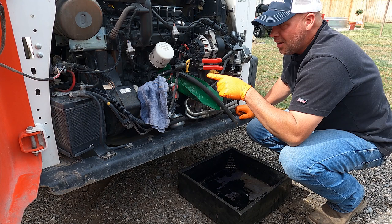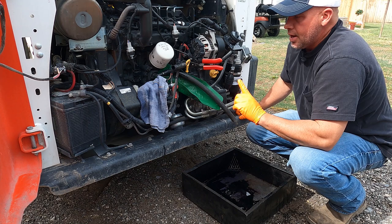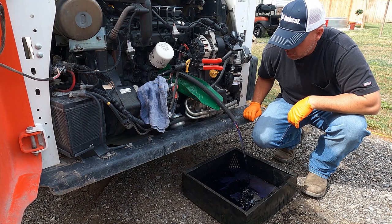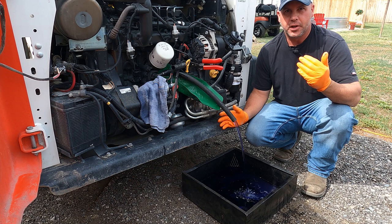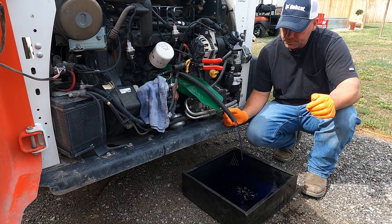After we removed the radiator cap, I screwed it back on — that helps pull a vacuum in the tank to keep the coolant from flooding out so fast we can't control it. So nothing's coming out because there's a vacuum in the tank. Now we're going to release the cap and open it up, and this is going to continue to flow the rest of the coolant out of the system. That'll drain out 99% of your fluid. I don't usually run water through to flush because this propylene glycol solution in these engines runs so clean — I just drain it all out, refill it, and it's good to go.